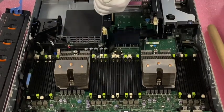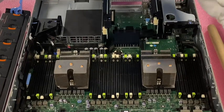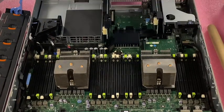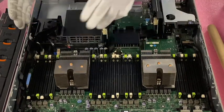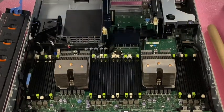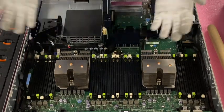If you're trying to max out with ECC registered, you'd use all the whites and all the blacks and none of the greens. That will protect you from the rank rule because that only gets you to eight ranks per channel. That's why you can't use the third slot — you'd essentially break the rank rule.